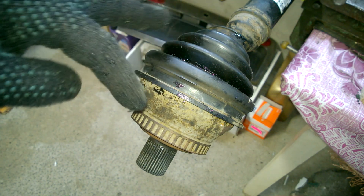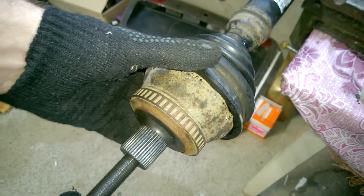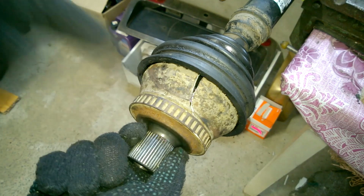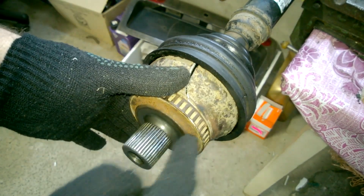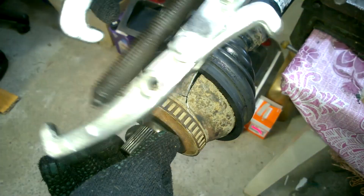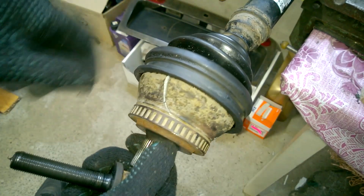However, things didn't go as planned. I removed the axle along with the joints and then started screwing in a bolt to pull the CV joint off the axle. In the end, the thing I feared most happened — the joint housing cracked. The problem is that the circlip on the axle wouldn't let the CV joint come off. I tried hitting it with a hammer and even used a puller, but after applying a lot of force, I ended up breaking the housing. Cracks formed all around. I wanted to replace just the boot, but now I'll have to replace the entire joint.